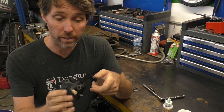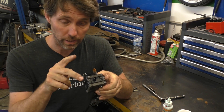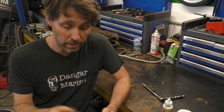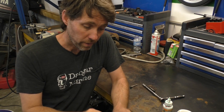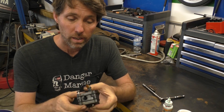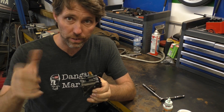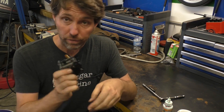A few things I've noticed about this fuel pump now I've taken it off — I'm not that familiar with Mercury fuel pumps so I'm learning as I go. Two of these bolts actually hold the housing together rather than holding it onto the casing. Also, these appear to be a dual action pump. Most Yamaha fuel pumps have the vacuum port on the back going straight onto the crankcase, but this one also has that external hose feeding the other half — connected to different cylinders — so as those two cylinders go up and down you get an oscillating dual action pump, increasing flow rate.